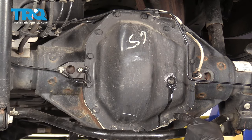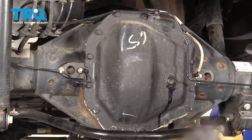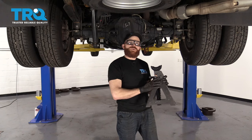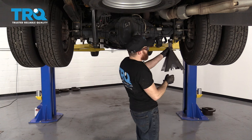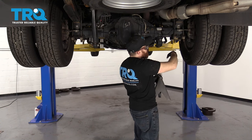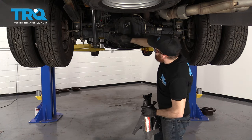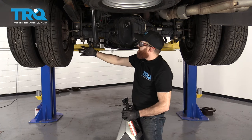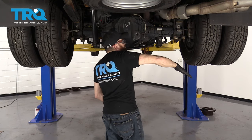I'm going to bring down the vehicle and tip the differential using some jack stands. We're going to take this jack stand and put this end right about here — we want to make this wheel about five to six inches higher than the ground, and that's going to tip the differential. With the differential tipped, it's going to allow fluid to come down through the tube and lubricate those bearings on that end. We're going to let it sit for approximately five to ten minutes, then jack it up and switch it over to the other side so it's tipping in the opposite direction.